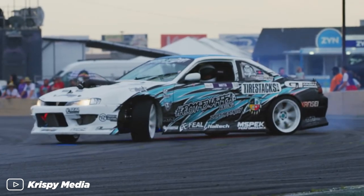Listen, what makes a roll cage safer on the track actually makes it very dangerous on the street. Because on the track, you're gonna be wearing a helmet. A simple fender bender on the street though, you might be bouncing your head off those thick metal pipes. Especially in a tight sports car, these tubes are going to be literally a few inches away from your skull. So if you're gonna drive your car on the street at all, a roll bar is a great compromise. It'll give you adequate protection and chassis stiffness while being safe on the street and easier to live with.